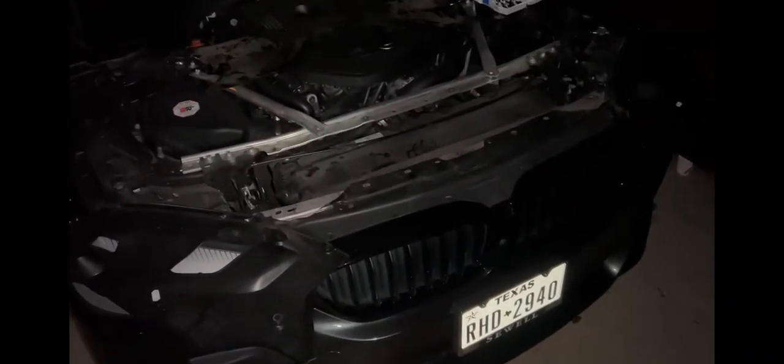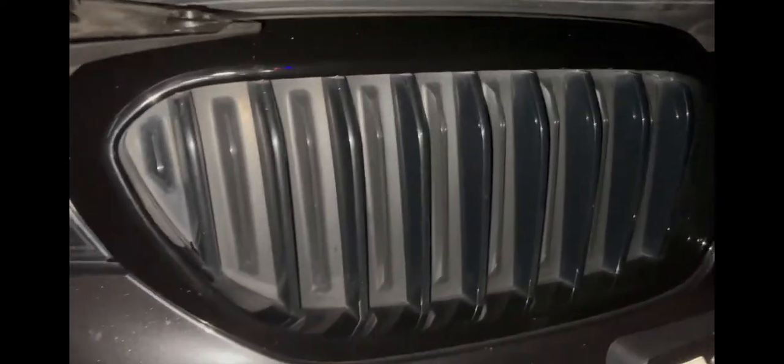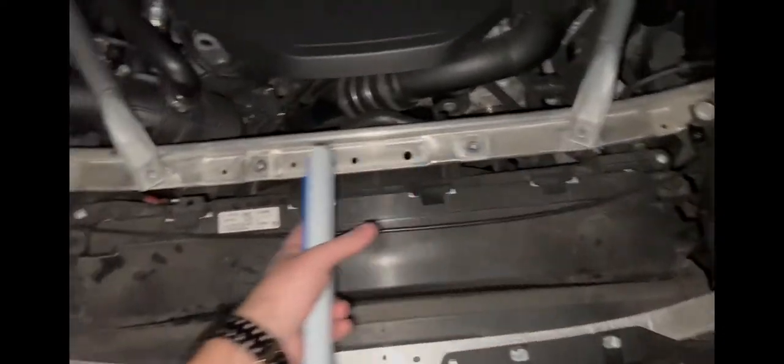Here's a quick little demonstration. I didn't record all the steps in detail because I didn't have too much time, but take a look. Alright, so here's a 2018 BMW G30 and I'm installing the V-brace covers. You can't access it from the front because of the active grills and there's not enough room. So what I did here is I removed this black plate that was on top of the heat exchangers that are under this cover, and then looking back there I can see the V-braces.